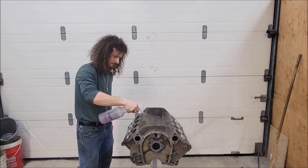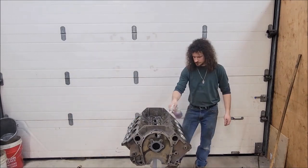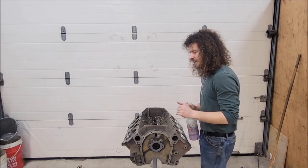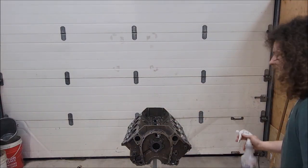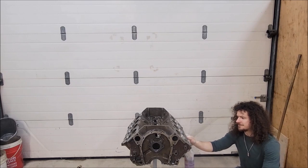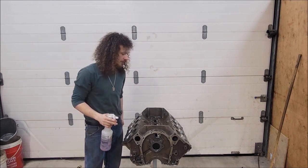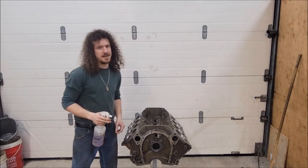Let's do inside the lifter valley. For the record, I am not painting this — some people do, but it's just not for me. The whole idea behind painting a lifter valley is that the oil won't cling to the cast iron because it's very porous; if you paint it it'll be smooth, the oil returns a lot quicker and stays cooler. Those are guys trying to squeeze every ounce of horsepower out of an engine. For this build, I'm just building it to perform better than what's in the current vehicle — it replaces a little 283, so it should be a bit of an upgrade, and it should sound pretty nice when she's built.